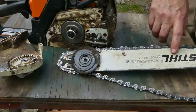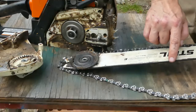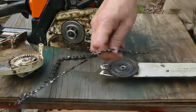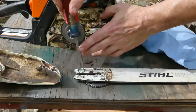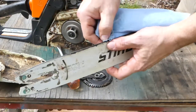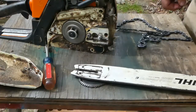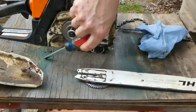You'll notice that my chainsaw blade in this case is upside down. It's a good idea to rotate your chainsaw blade back and forth. It's also a good idea to take a light file and go along the corners here — you will see a burr develop over time, and that can interfere with your cut. So we're going to take this old chainsaw chain off — it just comes right off. Now different manufacturers have different ways of flipping your bar over. In this case we just have this screw — just take this screw out. I'm also going to wipe down the galley where the chainsaw chain runs. You can also blow this out, use a brush. You might want to put in a little light coat of oil on it. Then we flip our bar back over once it's cleaned, put our screw back in, and that's all there is to it.